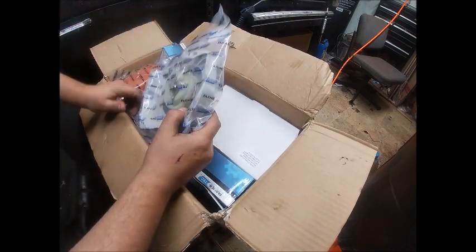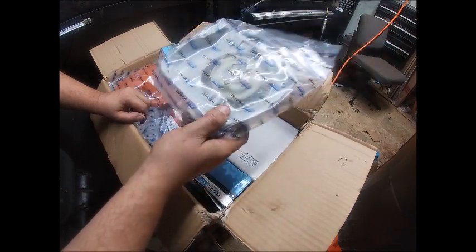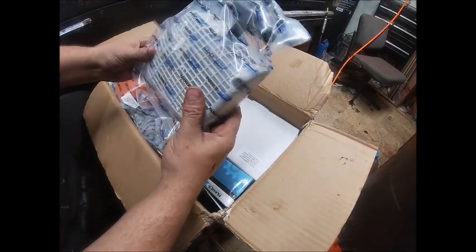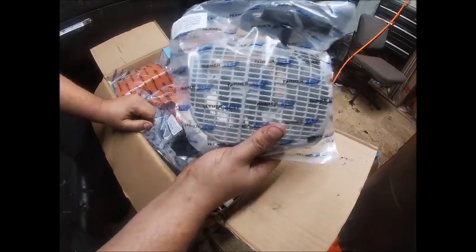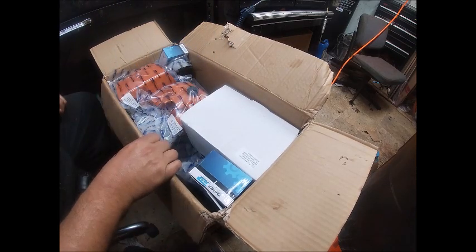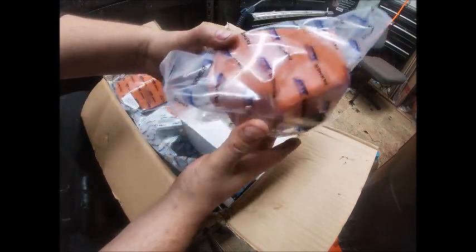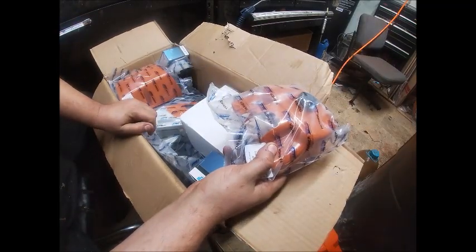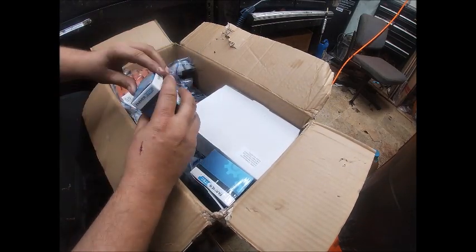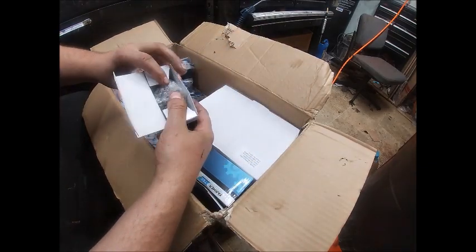These are like a big model car. If you were to print off an IPL, you could put one together just watching a couple of my videos or other guys' videos. Once you get the crank cases assembled it's kind of all downhill from there — they're a really fun project. The Farmer Tech plastic has improved a lot over the years. Some of the first stuff I got you had to highly modify to make it fit. Nine times out of ten this box is going to be your carburetor, and Farmer Tech carburetors are a hit or miss just like any other aftermarket carb.